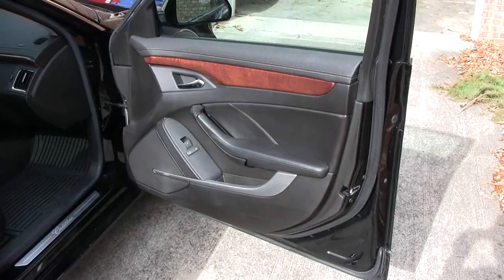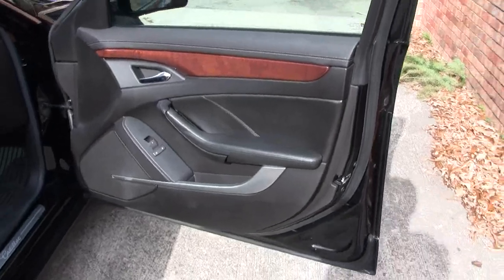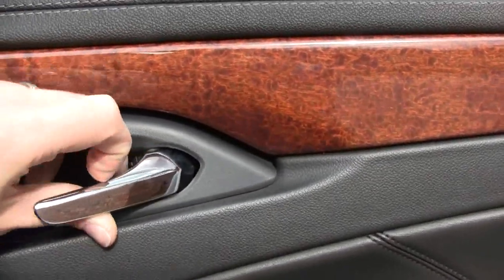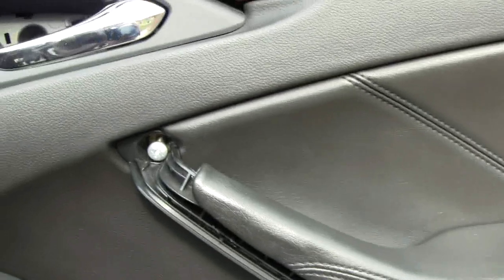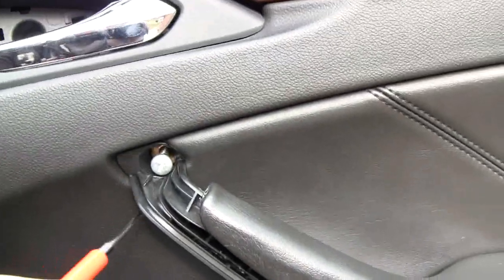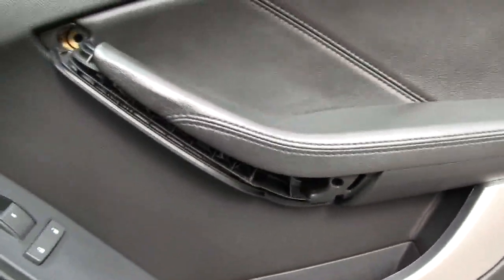We've opened the door from the inside. There are only three screws that hold the inner door panel on, which is what we have to remove to get to the microswitches. Behind this panel here, there's a plastic bezel that you can pop out — just pop it out after you loosen it up. There's one screw there, and a third screw there. A magnet is a handy tool to have for this. That's really all that holds the panel on, besides a bunch of clips.